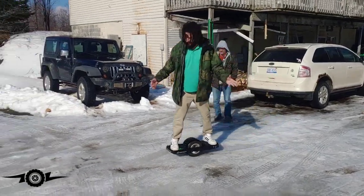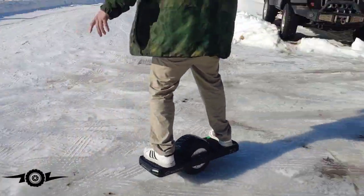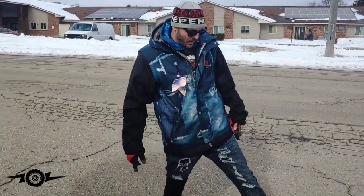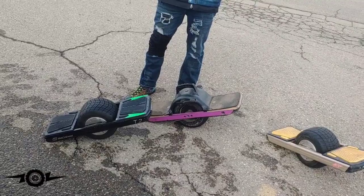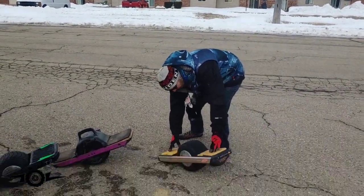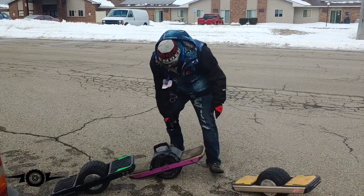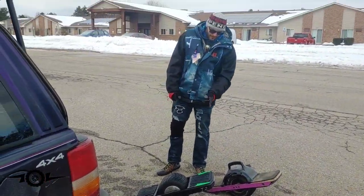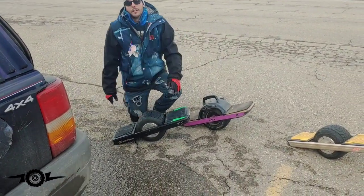If you knew how to ride the other models, they're really temperamental. We're out here today to test out the new Vesk mag wheel. Got one of the OG Trotters right here, got one wheel XR, and we have this new Vesk build. The Trotter has a sensor here and here — you activate both of them and it wants to level itself. The XR has both sensors, you level it and it engages. Same setup for the Vesk mag wheel, but this one's set up as a posi, so only the front sensor is going to activate it — and it also activates on level.